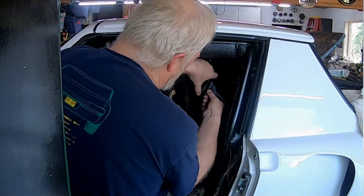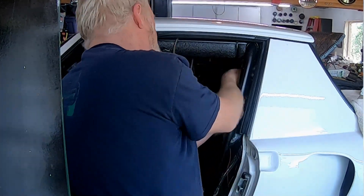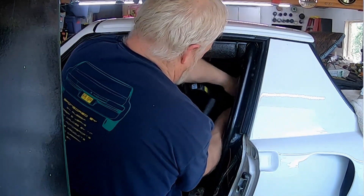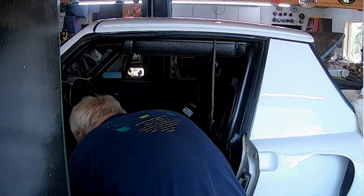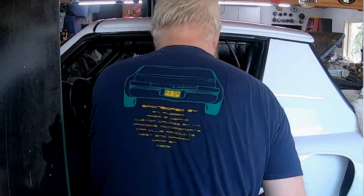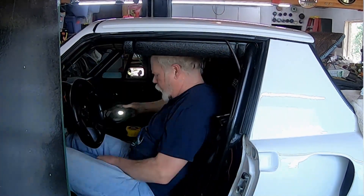Now your sanctioning body might be different — that's SCCA rules and I'll show a diagram of that here in the video. You can see how that is what I want on mine. So all of my straps will be mounted like this: through a bolt and then looped just like that, and we should be in good shape. All of the harnesses except for the shoulder harnesses, which will wrap around the harness bar, work the same way.